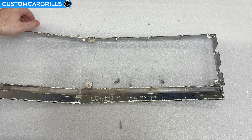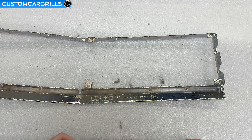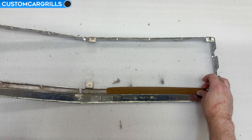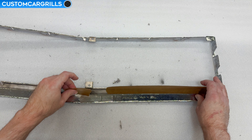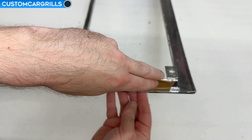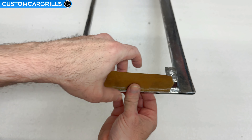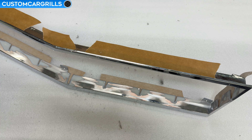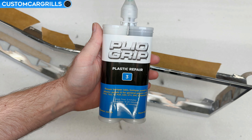This starts by using some tape to temporarily bridge these gaps — we'll be using this surface to dispense some epoxy onto and then remove later. It's best to have the tape line overlap a solid half inch or more because there will be some spillage. With the sides, be sure to have full coverage on those big gaps. We don't want any of this epoxy leaking through and running all over the place.